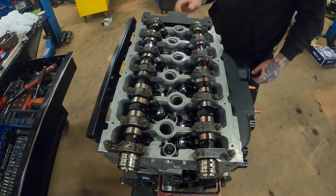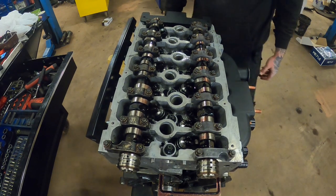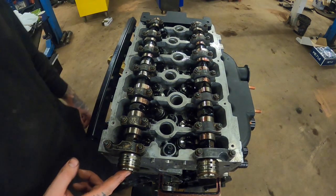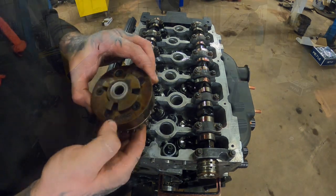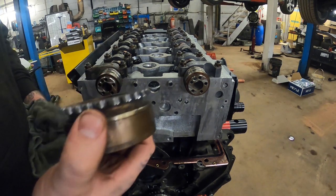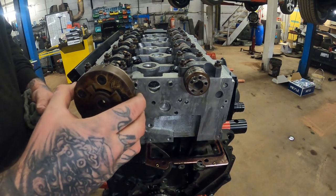The setting bar still goes in nice and flat on the head and still moves - it's not stuck or bound up, which is good. The crank is in the right position so everything should be ready to put the chain on. The only things left are the cam pulleys. I just realised you can't put these on yet - there's a housing that the cam adjuster fluid runs through which needs to go on before the pulley goes on, otherwise you won't get it on after.